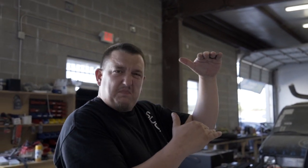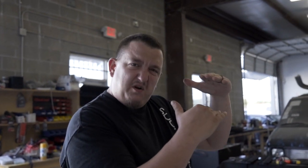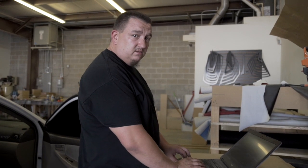And if box rise goes back down to 1 ohm, you're still making your 5K, I got 2,500 watts of sub. Right now, it looks like I've got about 250 over RMS to each sub. So that's about 1,850 a hit. They're rated at 1,600. Sundown says they put 3,000 watts on them for 24 hours, free air. That ain't bad.